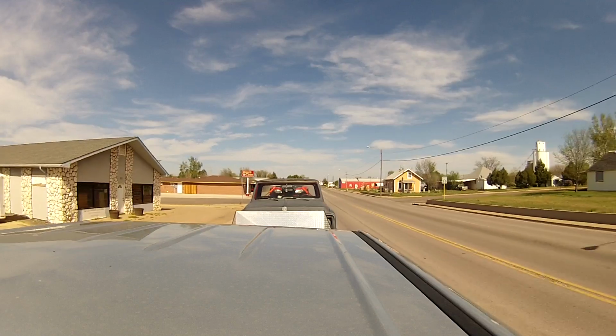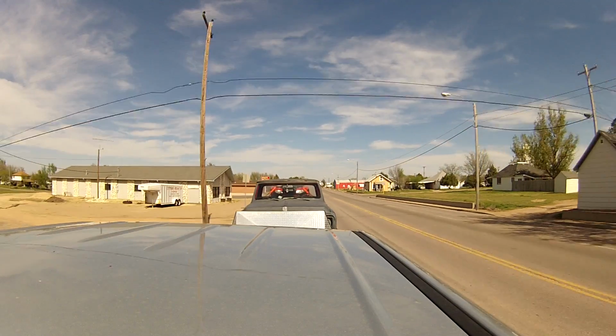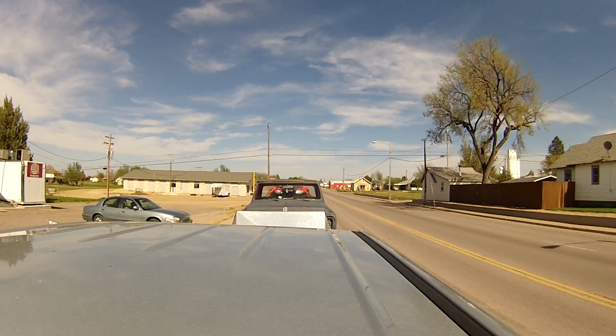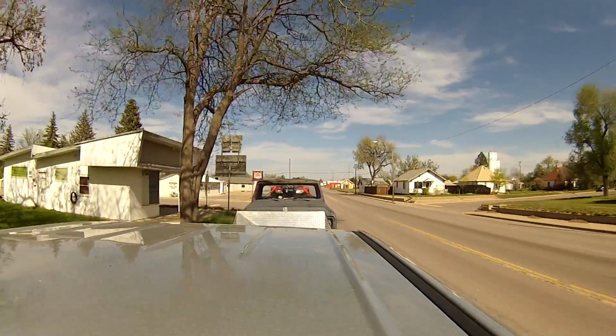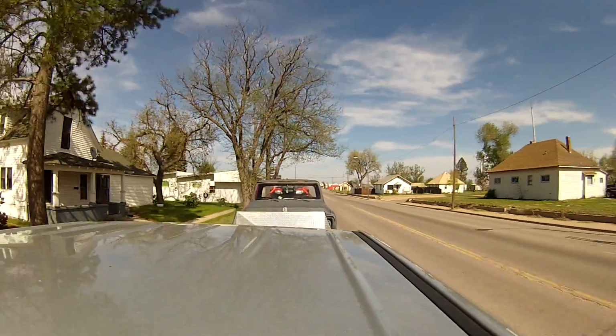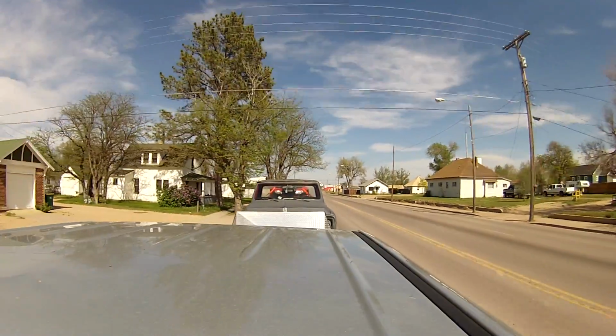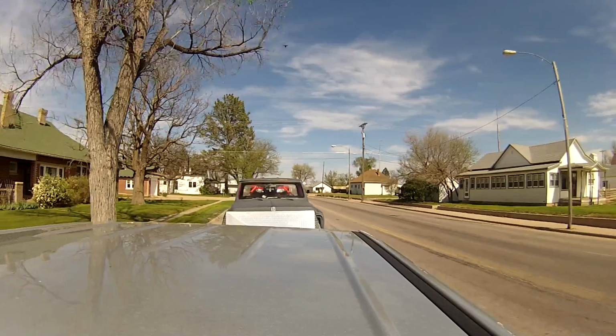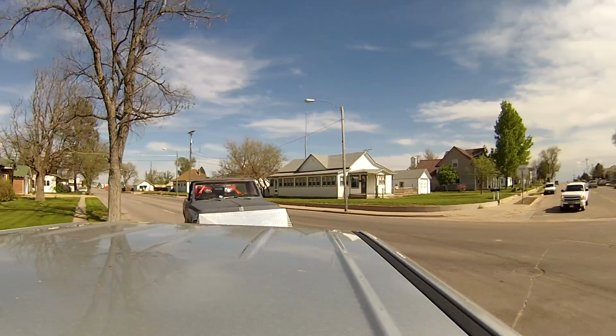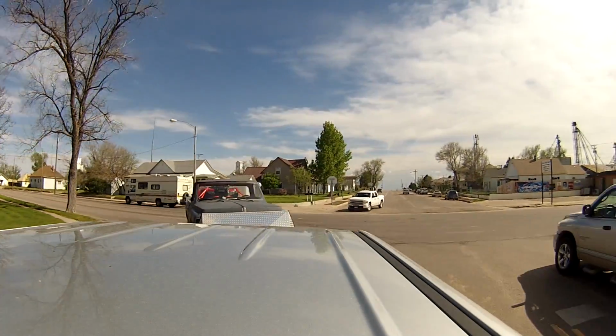And now we know that the Load Trail tires, the Gladiator tires that Load Trail puts on their trailers that are designed in Arizona, where Gladiator's at, are M-rated, which means they're rated to go over 81 miles an hour. So we can go at least 75 when we're on a primary road. We're on a secondary road now, so we're going to go 65.